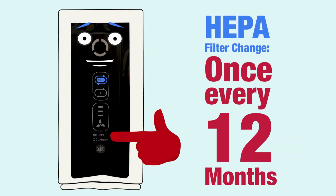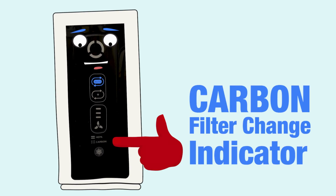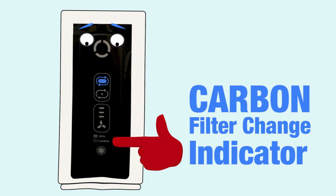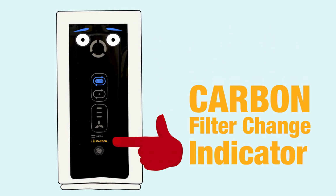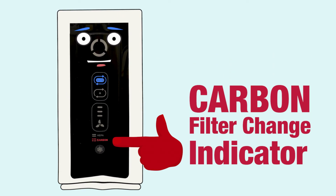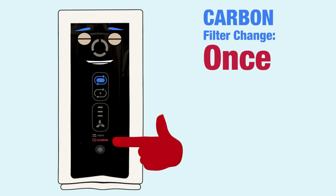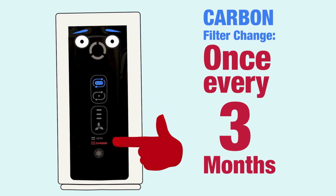The second filter change indicator light is right under it, my carbon filter change indicator. Again, the amber light is just the warning light, but when the light goes red, it's time to replace my filter. The carbon filter needs to be replaced every 3 months under normal usage conditions.